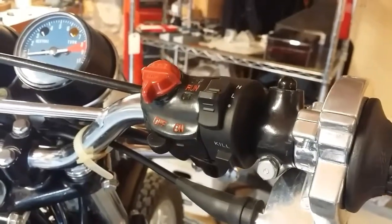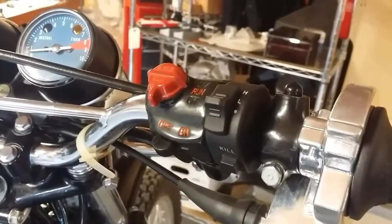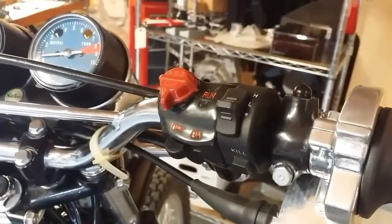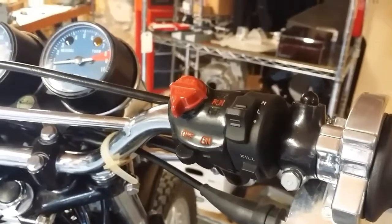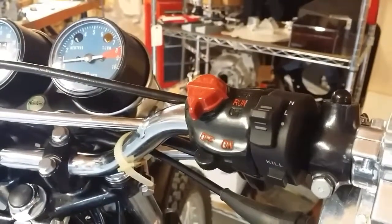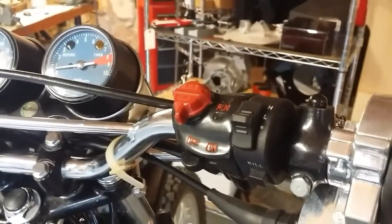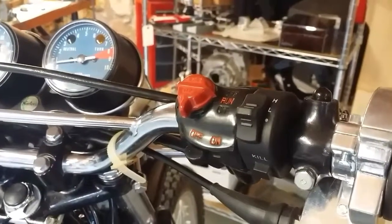As I mentioned at the beginning, these bikes use three separate electrical systems. The headlights run off their own alternating current, unregulated — which I've now regulated with an AC regulator. The tail lights, stop light, turn signals, and horn run off the battery on DC. The third circuit is another AC unregulated circuit that goes through the ignition coil, allowing the ignition to run without a battery. One problematic thing is that both left and right switchgear combine the switching of DC and AC current — though on separate switch contacts, they share a common ground, and I do believe there's some bleed over.